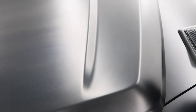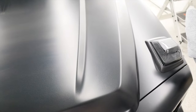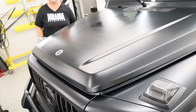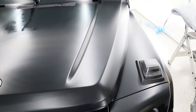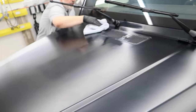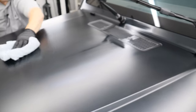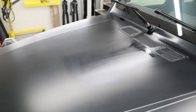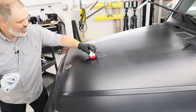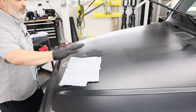Don't make yourself miserable — just use more towels. If your towel is overloaded, you'll see little spots appearing where you're putting product down instead of picking it up. Time to flip or grab a new towel, and just like that, those spots are gone. Also note the very long working time. If you push too far and end up with a high spot, our coatings are cannibalistic — meaning if you catch a high spot within a reasonable time, just take your applicator saturated with product, go back over that spot, re-emulsify and re-activate it, then pull it right off.